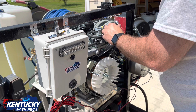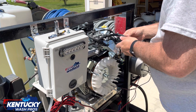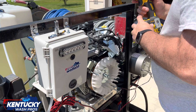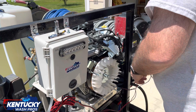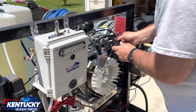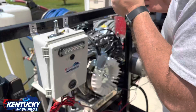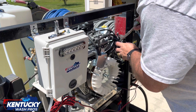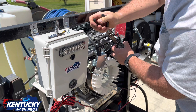I like to do one line at a time. I know this is the fuel line coming in — it's got to go to that one. I'm going to put my impact on a low setting so it doesn't over-tighten and break anything. Get that clamp off there. That goes to the diaphragm. Put that on there, get your clamps, get your pliers — needle nose, whatever you've got.